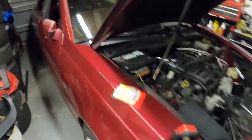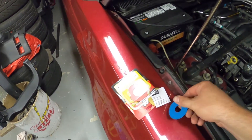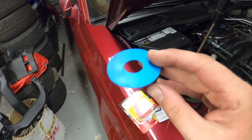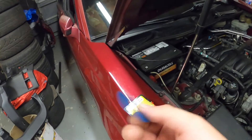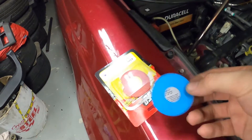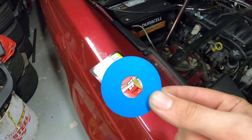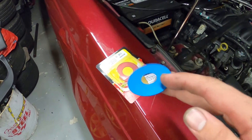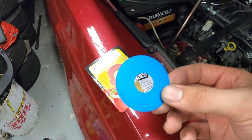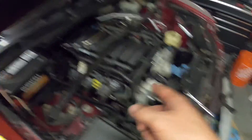So what I did was I ordered some thermostat restrictor plates to remove my thermostat but still control water flow. These were ones made for LSs and Fords, done by Moroso, and I just took a shot in the dark — they're cheap, I grabbed them, but they're too small. Turns out the 3000GT thermostat is light years bigger than an LS thermostat, but these are going to come in handy for this car.